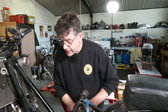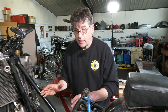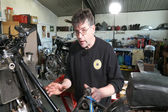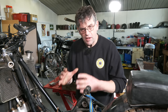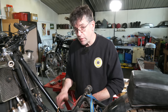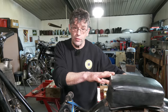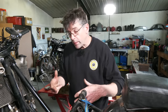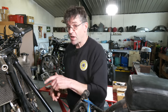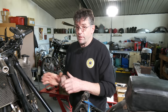We're not going to cover very much on the Scott today, but we are going to do a proper video on it. My next job will be reinstalling the carburetor — clean it out, put the carb back on, put the windows back on the transfer ports. We'll cover the carb up, clean a lot of the crud away with brake cleaner, then put the tank back on after flushing it out. We'll get the pump to make sure we've got a flow — put the bike on rollers, spin the back wheel, and make sure the pump is pumping properly before we try and start it. That way there's no chance of starving the engine of oil.